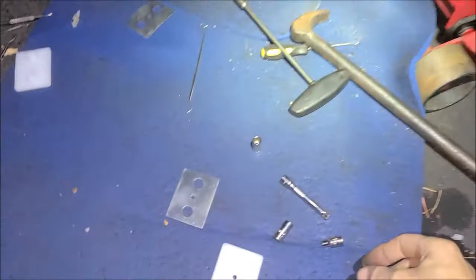And then we'll have to do some adjustment here. We got to get that back in place. Actually, I'll probably need to do that right now before we... Because this, from the factory, it looks like it's about a half inch down, according to the other side. And then we'll have to do some fine-tuning, I think, with the end piece to get the paint lines to line up. So we're getting closer. Okay, so you see what's happening here? We tighten this up. And as we do, we're closing up the gap on the end.